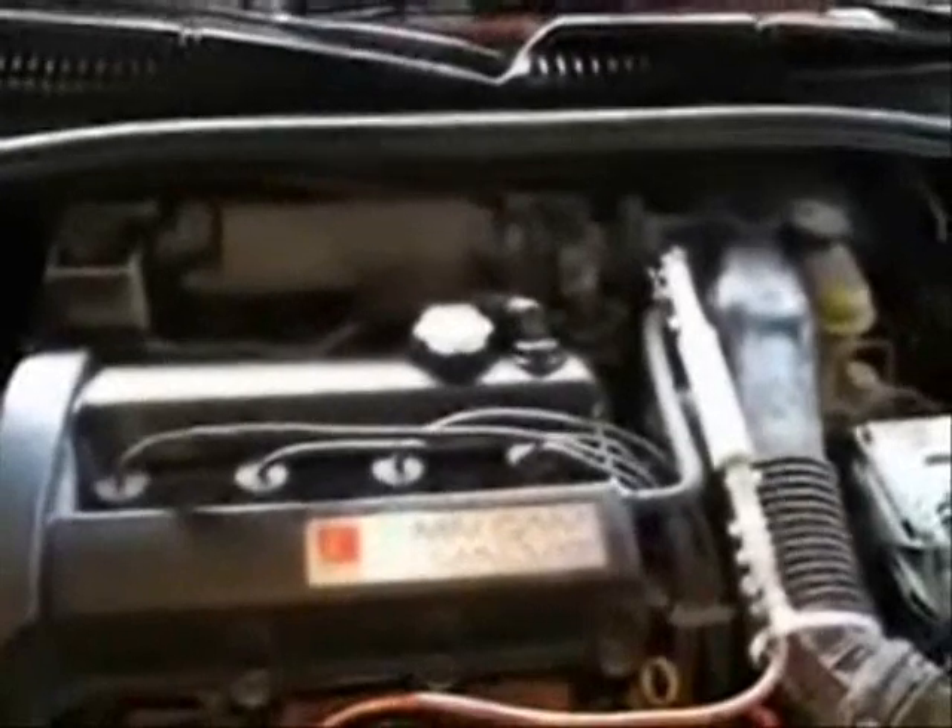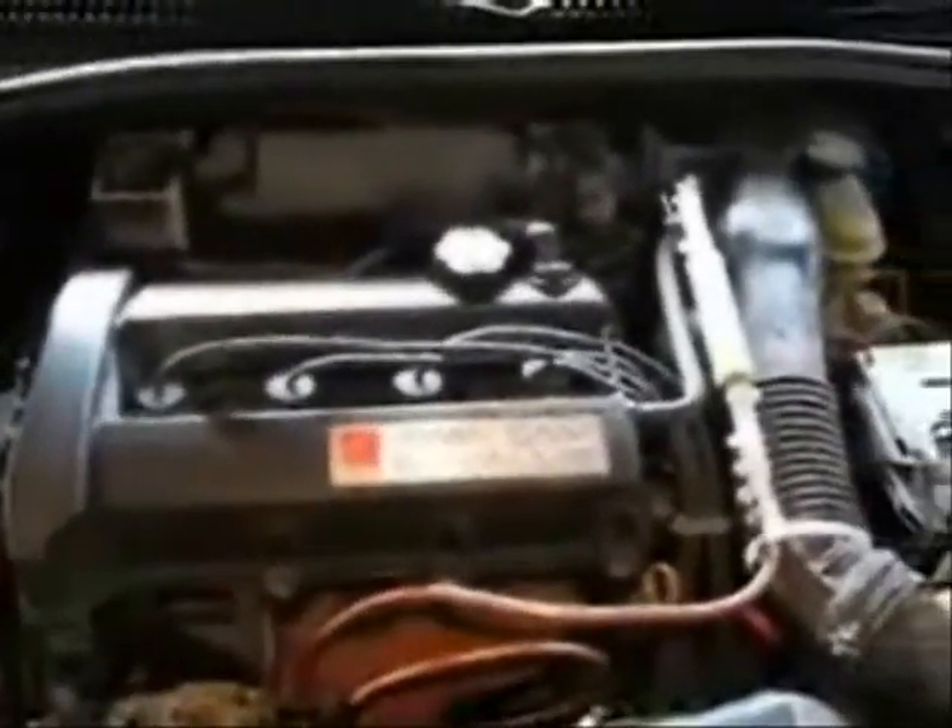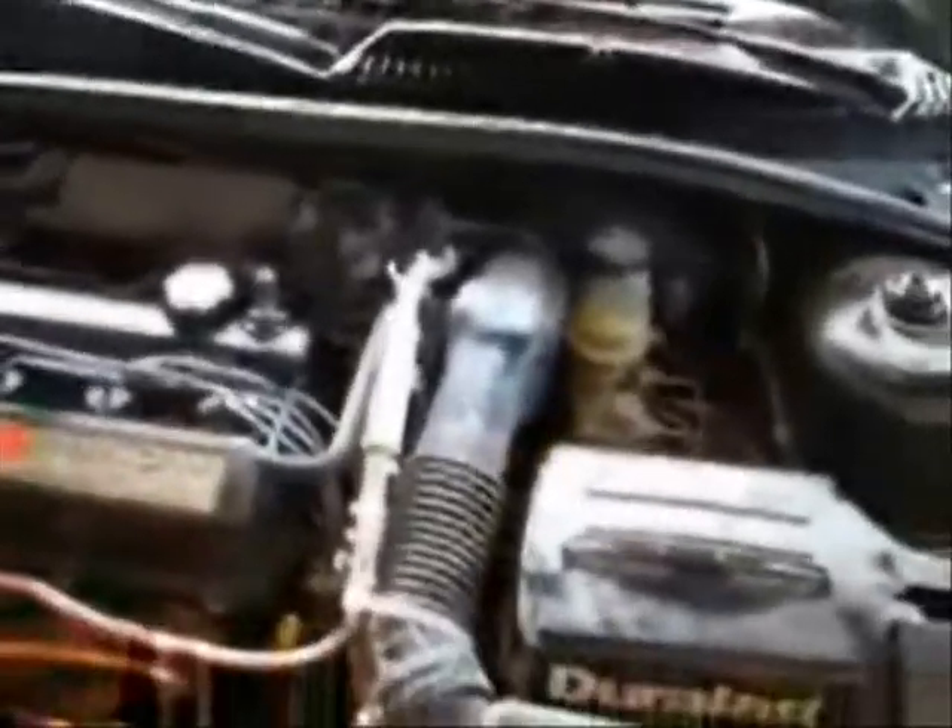So there's a bit of a vacuum there. I used to have it hooked up right here where the PCV valve goes in. The problem with that is it's on full manifold vacuum and the water in the cell boils at about 140 degrees or something like that. So I don't want the water boiling at that low of a temperature. So I moved the injection point to here.